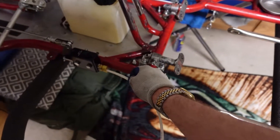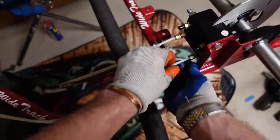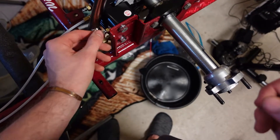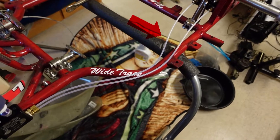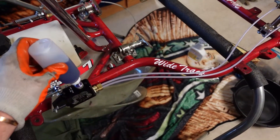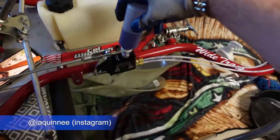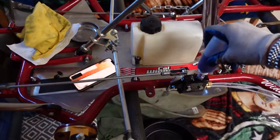Installing the brake lines now so the hydraulic brake fluid can go from the master cylinder to the calipers in the back. Loosening the bleed nipples so I can bleed the brakes, get the air bubbles out of the system, and fill the brakes. You can see the brake fluid filling up in the lines as I pump it through — and it squirted out, went all over my stuff. But there are the brakes — they somewhat work. If anybody has better suggestions, let me know.